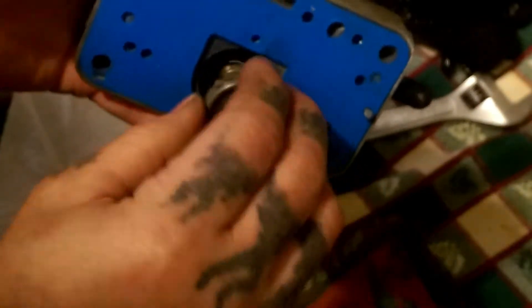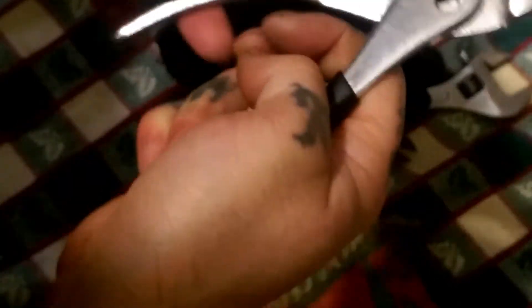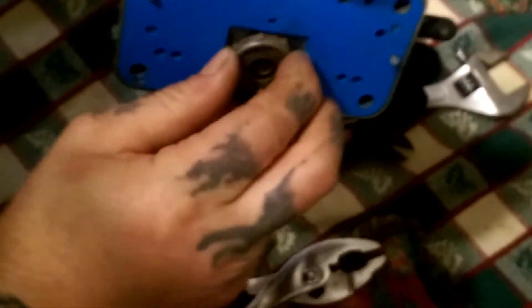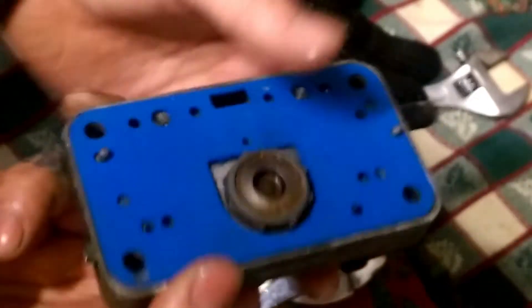When installing your power valve, you can take it and just screw it in. Make sure your gasket is level. Take some pliers and grab onto it like so, and just a little twist — don't need a lot, just a little twist. And that should pretty well have it. Now you can go back and reinstall it. Looks like this gasket is still usable — we can put it on and try it. That's the main thing — the metering block is taken care of.